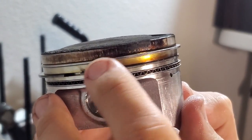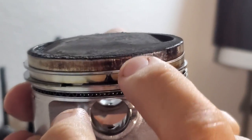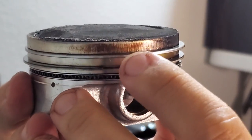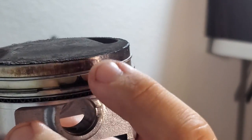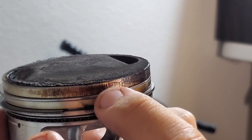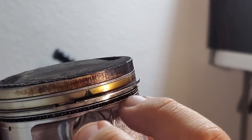What's really important to note: if you push the top compression ring out and rub your finger against it, it's very smooth. If you push the wiper ring out and run your finger up and down it, it has an edge to it. The compression ring is smooth, the wiper ring has that edge. So we're going to mimic this setup — the smooth one goes up top, the one with the edge goes right below it, then one ring above and one below your oil ring, with the squiggly oil ring in the middle.